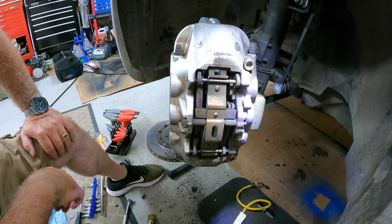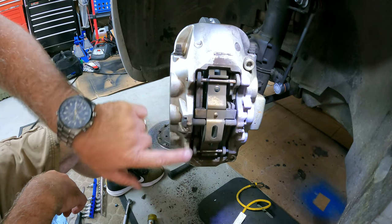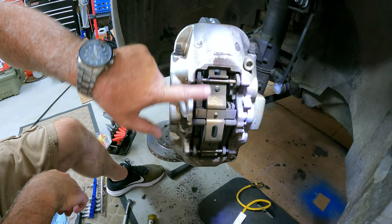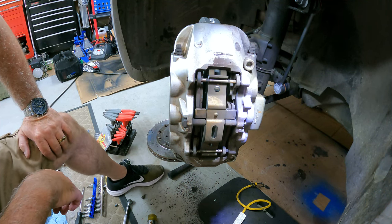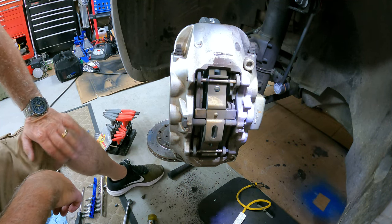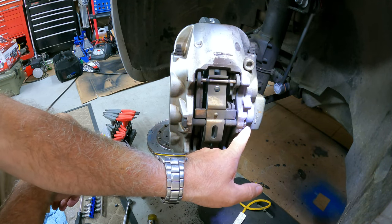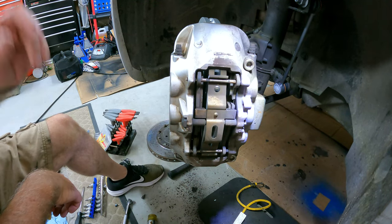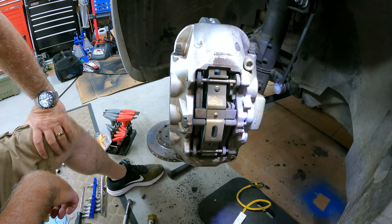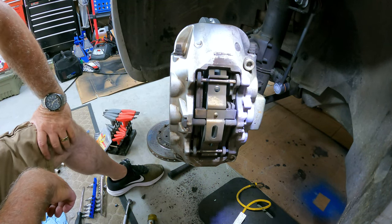It's pretty simple. You have this clip in here — you want to make sure that when you pull this apart you put it back together the exact same way that it's in there right now. Not a real difficult process. I've got to grab a socket to pull that one off, and then a drift pin to push these pins out. And then I've got to grab the brake grease so that when we put it back together it slides the way it's supposed to.